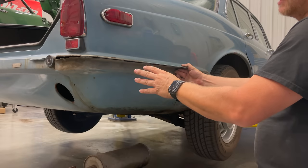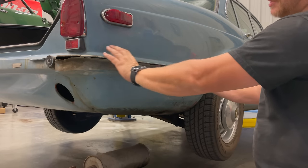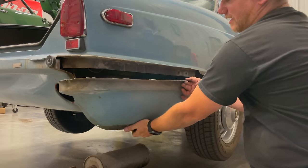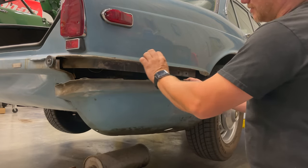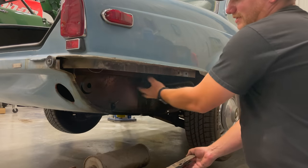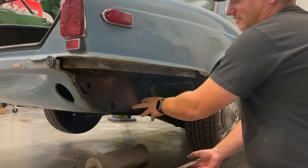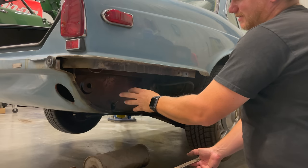To get the fuel tank out of the XJ6, the fuel tank is hidden inside the fender here, so the bumper needs to come off because this lower section that hides the fuel tank is covered up behind the bumper. You'll have to take your rear bumper off, then take off all the bolts to take this panel off, and your fuel tank will be hiding in here. In my case, I also took the exhaust off on this side to get better access, although I'm not sure that's always needed.